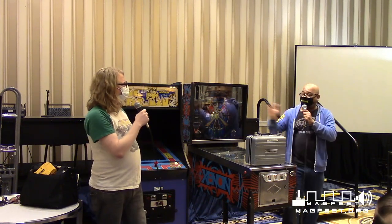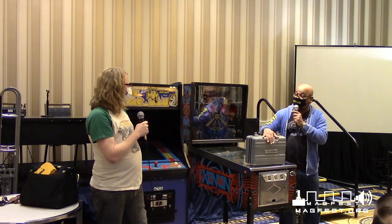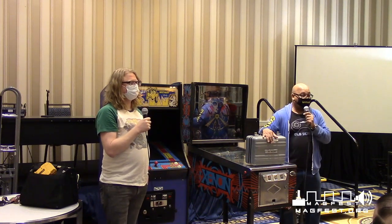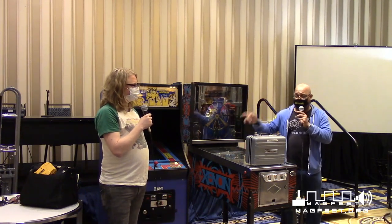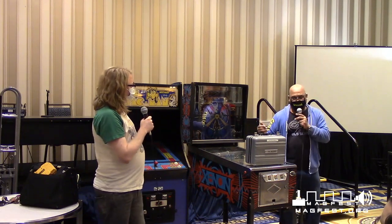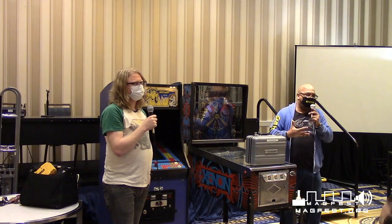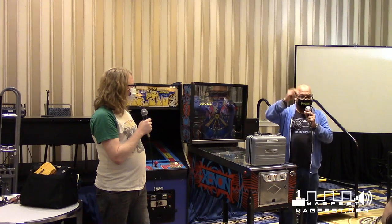Because the CRTs can hurt you a lot. I've been shocked by a CRT and it hurts. Have you ever been shocked by a CRT? I've been lucky enough to have never been shocked by a CRT. I've been shocked by pinball machines. I've been shocked by a CRT three times, and it hurts really bad because this holds a lot of juice, and if you're not careful, you have to discharge the thing to get all the electricity out of it, and even after you do that, it still builds up a little bit of a charge afterwards. That's when I made my mistake, because at the time, I was still kind of new, not knowing what to do with those, and there's a little cap on the back of the monitor, and that cap is, like, what's that cap called?